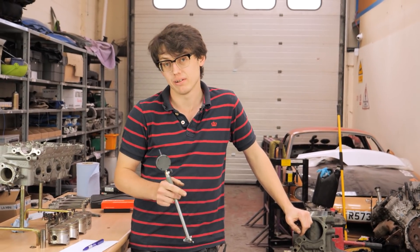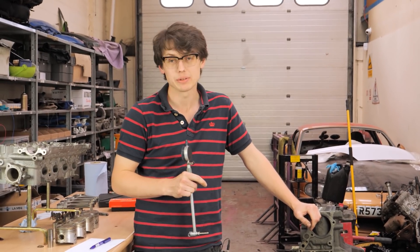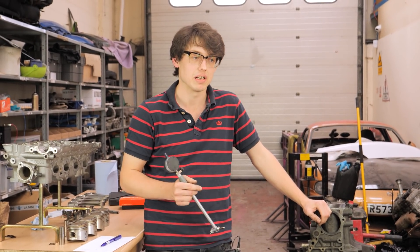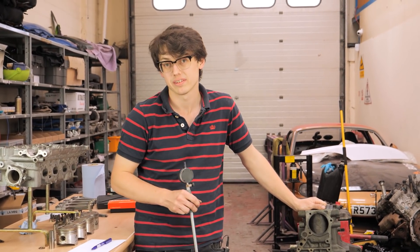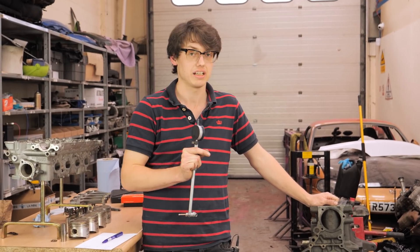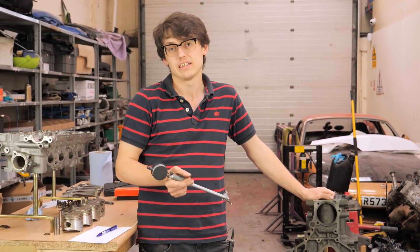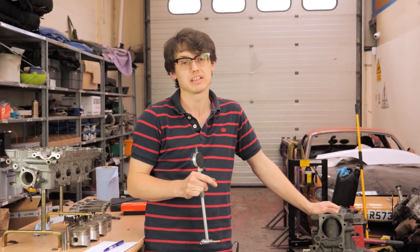Pistons grow when they get hot, and that measurement is critical in most engine builds. In this case we're putting stock pistons in this bore so it's less critical, but most of our builds use forged pistons, and forged pistons grow differently as well. Every manufacturer has a minimum spec for skirt clearance. The spec changes a bit based on what you're doing - if you're doing a turbo track car you're going to want more than the recommended minimum; if you're doing just an NA street car, the recommended minimum is enough.